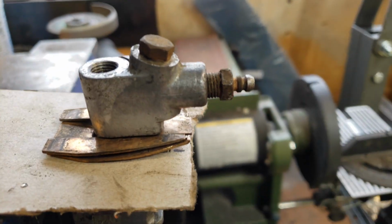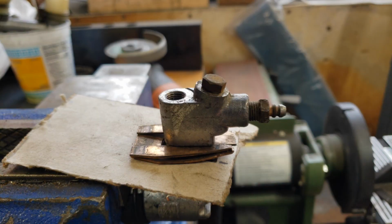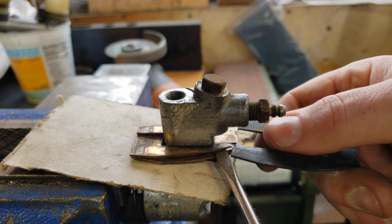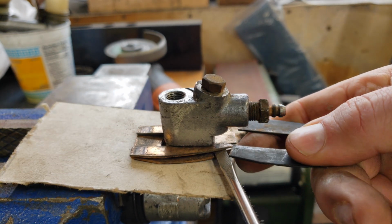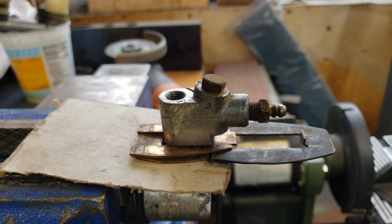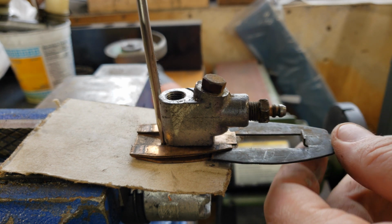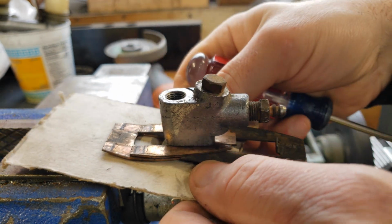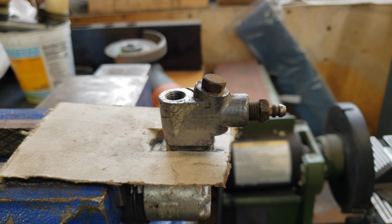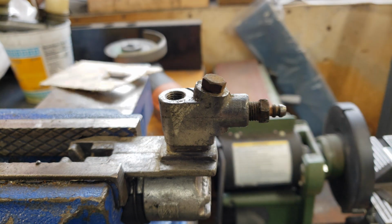And if you're trying to do this underneath the car with no idea of what's happening, it gets a little confusing. Alright, so there's probably 1,000 ways to do this to make it easier. The easiest way that I figured out was to take one of your shims and stick it in there, and then you get that so it's holding up both the tangs on there, and then you can slide this piece out here from the underside, and then both your shims come out the front, and then you can wiggle it out of the backing plate.